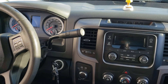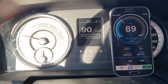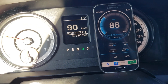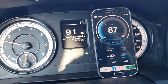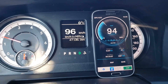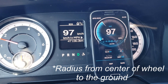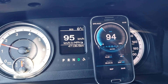Let's go for another quick spin and see if that worked. It took a few tries with different tire sizes to find the best setting for this truck, and it seems that almost a 34-inch setting works best. I think what it is — the tire pressure is a little low because of the winter, and I probably don't run as much pressure as I could, so the tire flattens down a little at the bottom. The actual diameter where it touches the ground is probably half an inch less than the overall diameter. So 34-inch seems to be pretty darn close.